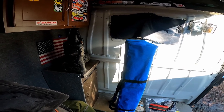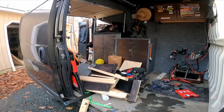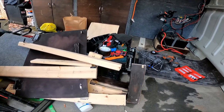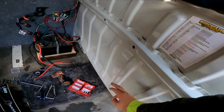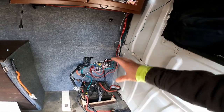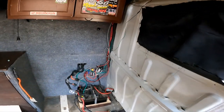After the mattress, I moved on to tearing the battery box apart and getting some of the bolts out of this wall. It's pretty easy — they're just Allen bolts, Torx, and 13-millimeter, and then you drill out two rivets. I want to get to a stopping point where I don't have to worry about this whole mess, but I should be able to get the wall out soon.